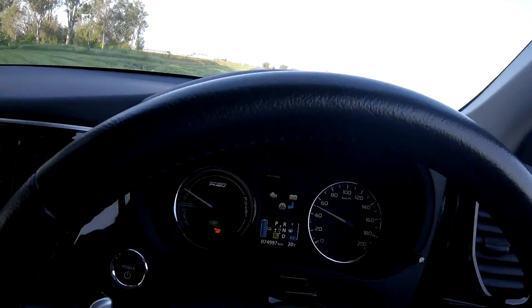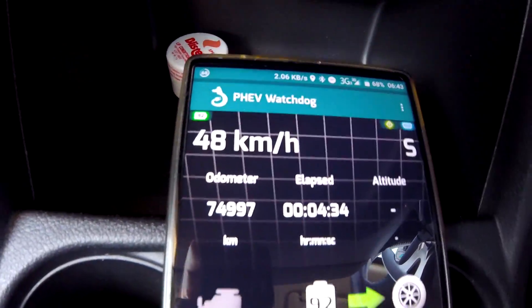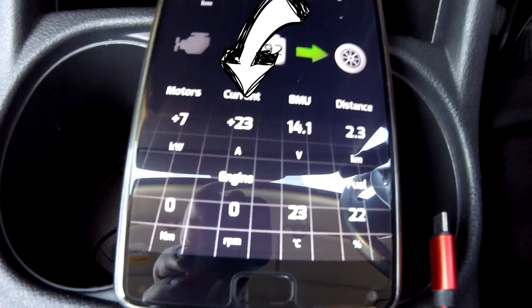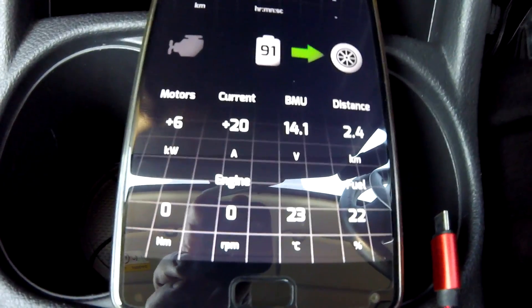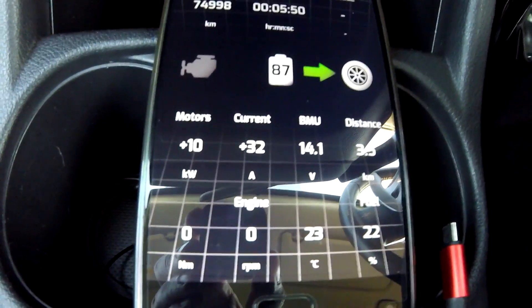To be honest, 6, 10, or 15 amp is a very small and low current for a big battery. If you see we are driving on a flat road at a constant 52 kilometers per hour, we are already using 22 to 24 amps out of the battery — and this is already more than the highest setting you can choose on the EVSE. At 72 kilometers per hour the current is over 30 amps — twice as much as the maximum charging speed with the built-in charger.